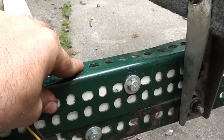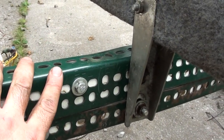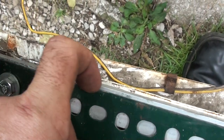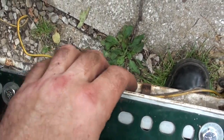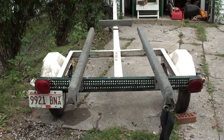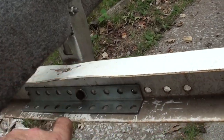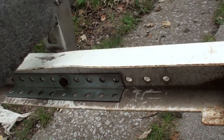It's not super strong on its own, but the combination of the old frame and laminating this together should beef it up enough. John boats aren't that heavy anyway, so it looks like it's going to work out. Anywhere there was a little gap along the top because of the waviness, I took some flat bar stock and put it in there, then drilled down through so it was held in place — sandwiched in there real nice. When we were done it looks pretty nice and level again. I had to straighten out those metal brackets up here, and I added a little piece of angle right here just to beef up this ledge so it would be a little bit stronger.